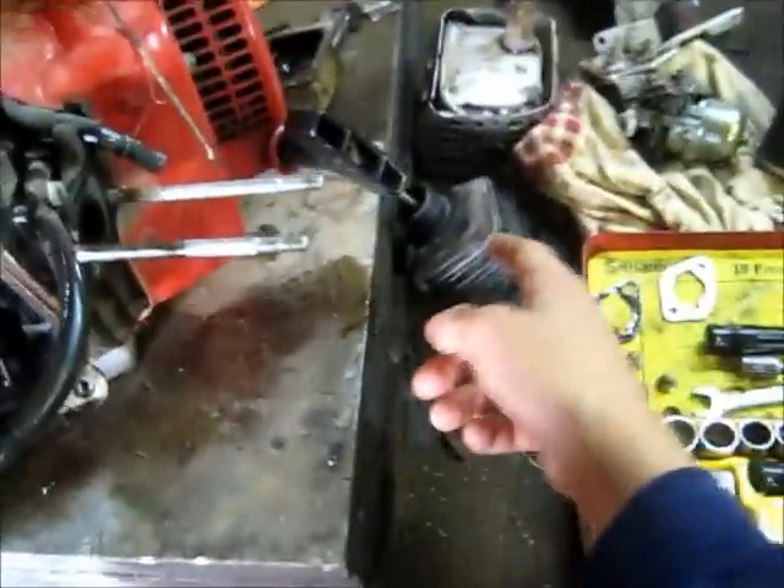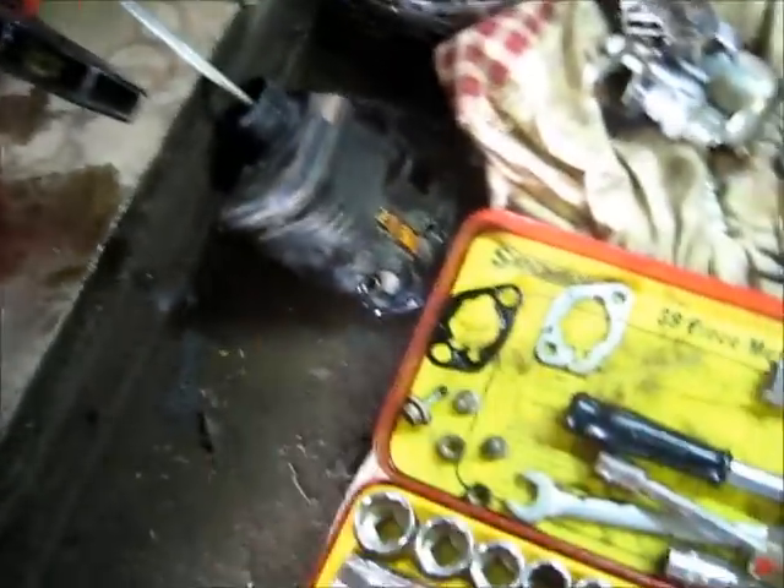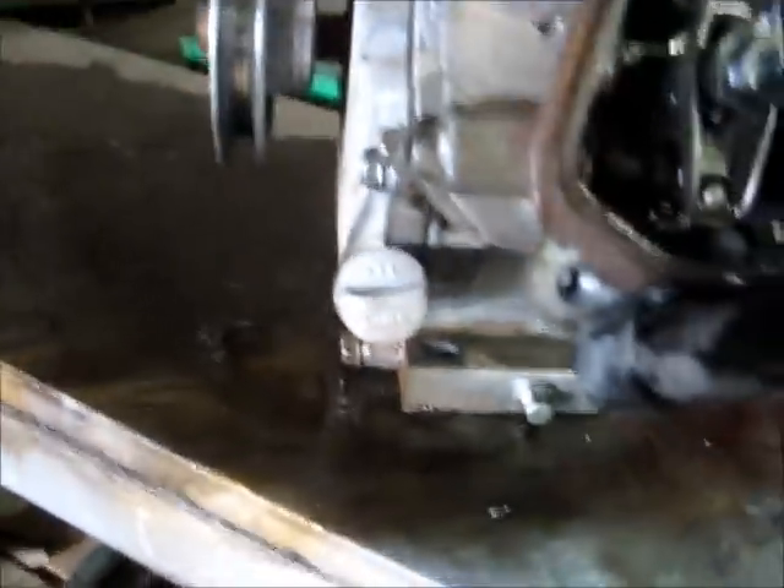This damn thing, I've got a woe-ful start. Bloody oil came out through to here, through the breather hose, up through there and clogged up the carby. It came up through here and just filled the carby up with oil. The oil was a bit coffee colour but the old man just went and bloody topped it right up with oil and overfilled it. Got bloody oil everywhere and into the intake, into the cylinder and locked it.